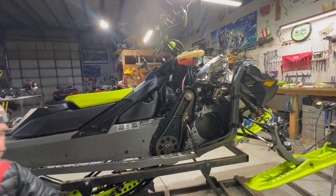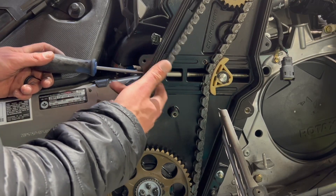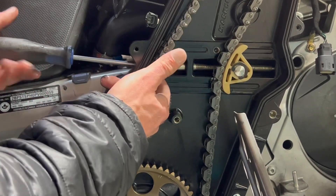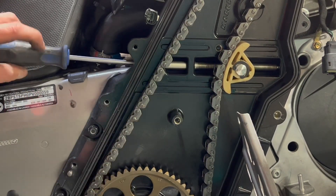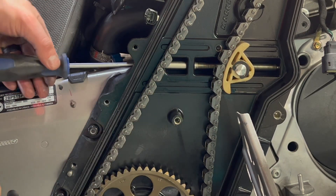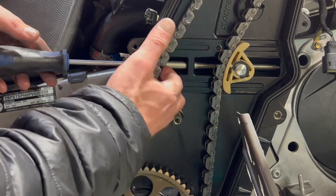Here's a better close-up view. The chain's still really loose. There's half a turn, there's a full turn — getting better. Another half turn. There's two turns and that's pretty good. I'm not putting a lot of force on the screwdriver — I would ride it there.